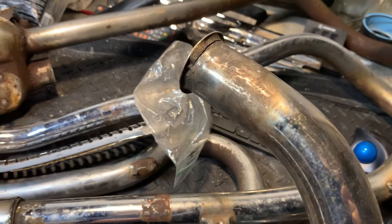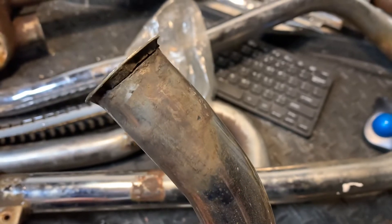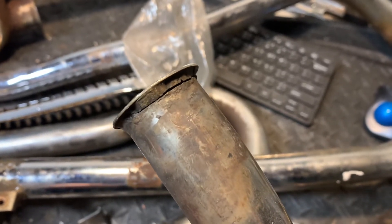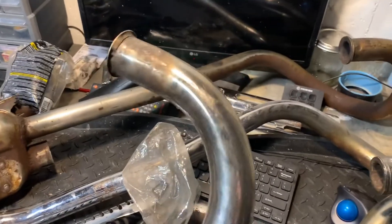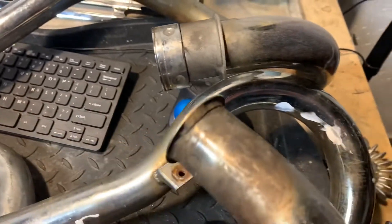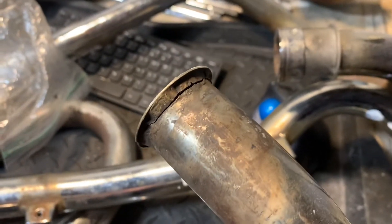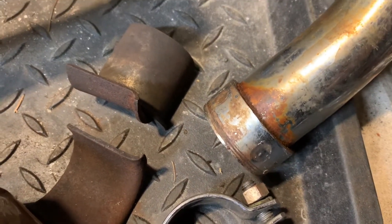The problem I was having is that on these thin-edged header pipes, they tend to crack. Look at this — this is the original pipe off my 1970 CB350. You can see that the pipe actually cracked; they just fall apart. I've seen a few of them this way on bikes I've been working on. I had to replace the header pipes. I found a source and ordered some, not knowing about this huge difference. The reason these newer ones are thicker is because I think they beefed them up because the originals were literally just breaking and cracking. On later models, they just started beefing up the end collar so you didn't have that problem.